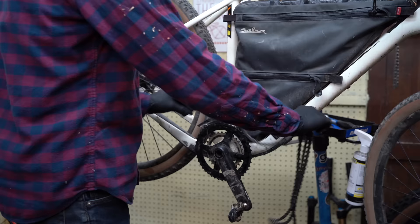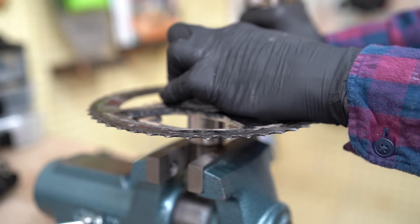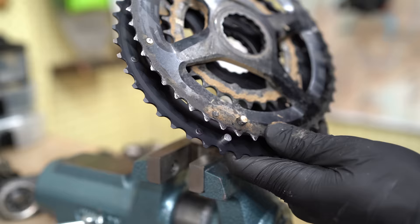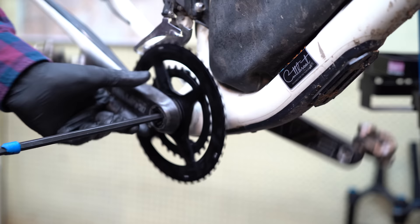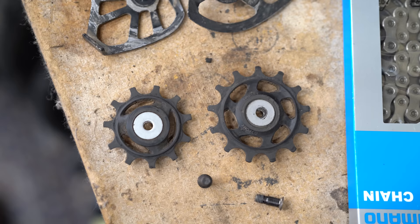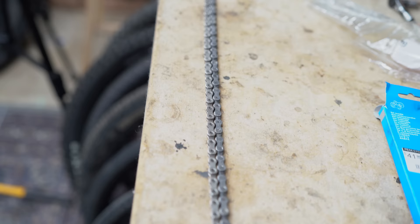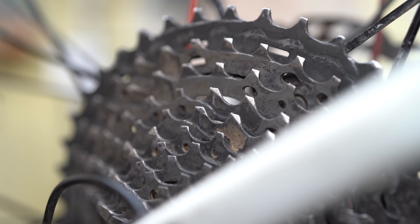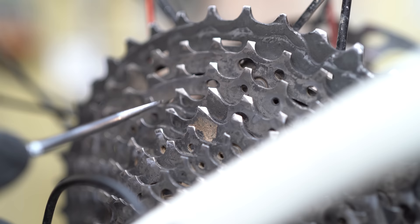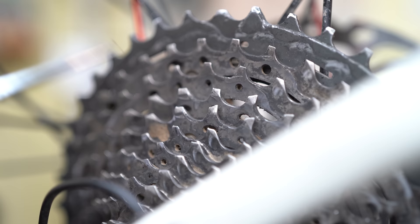After looking at all that, clearly some things need to be replaced. The chain for sure — that's toast. I'm going to replace the chain rings as well, but I'm going to try to see if the new chain will mesh up with this rear cassette. I'm a little skeptical given how worn the chain was, but why not give it a try? So this old chain is basically stretched out almost half a link length. Now that I cleaned off the cassette, more of these little spikes in the back got uncovered. The bigger and smaller cogs I'm not using as much, but the middle ones definitely show more wear. We're still going to test the chain on this cassette, but I don't have high hopes.